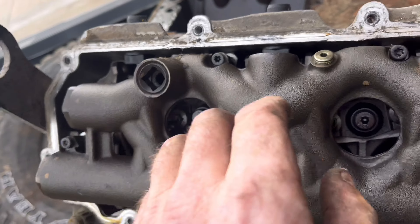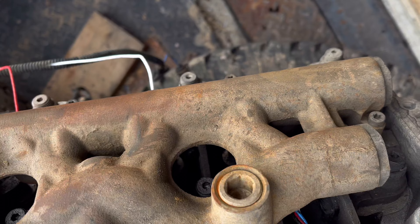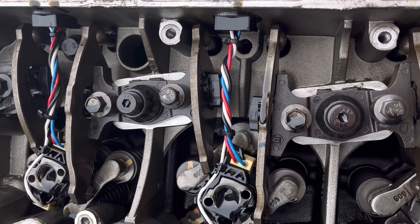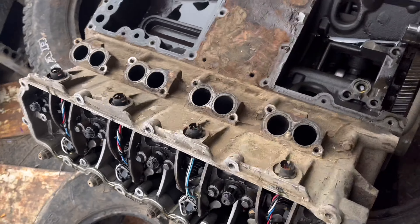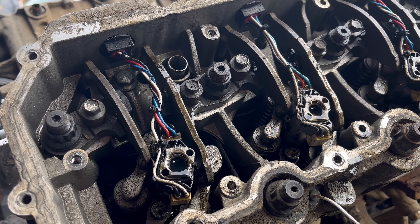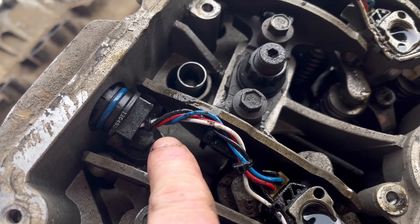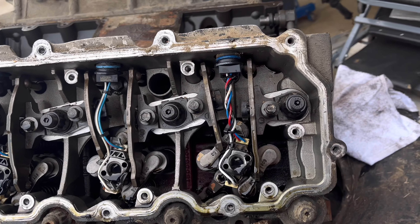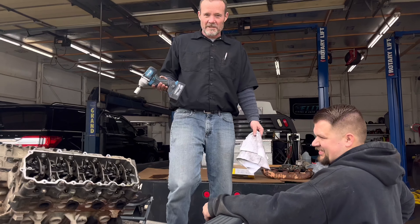Anybody want to gamble? Who knows when the Ford remand was actually done. If it was a Ford remand it should have had the same injectors consistently through it unless it was a long block type. Still got square drive dummy plug on the driver's side only, and a 10 millimeter stand pipe on the driver's side. But on this side we got a 12 millimeter update and an updated dummy plug. Does the aftermarket send those injectors out with all those twists? Looks like could be one Ford remand and three aftermarket hodgepodges. We got a set of cores. There's a 20 millimeter head right here, got 13s up on top.